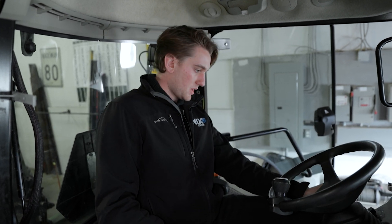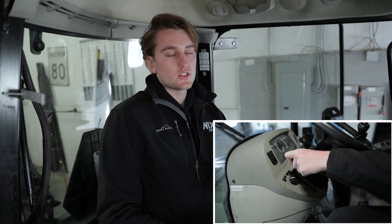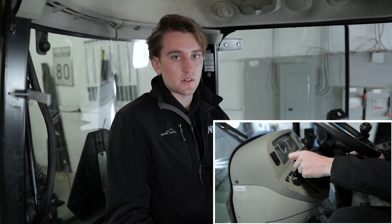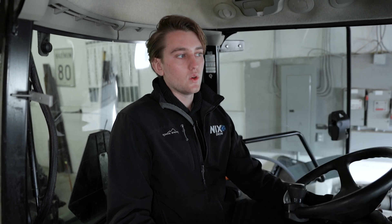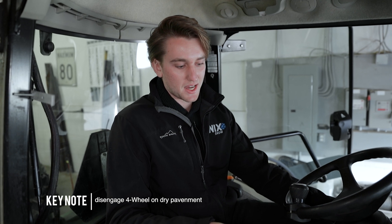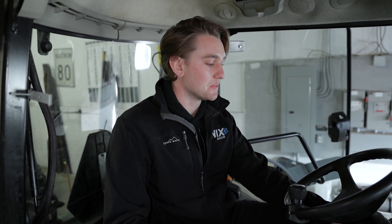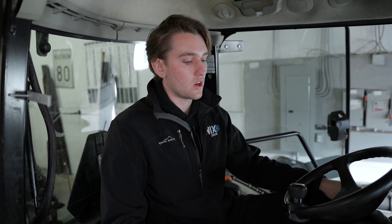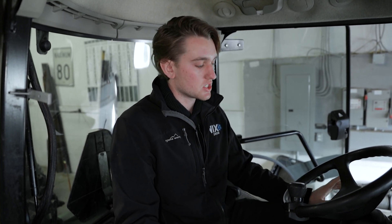On the left we have four-wheel drive control. This machine has snow tires on it. A lot of the time you're actually not going to need four-wheel drive. When you do, it's fine to use it. You just have to make sure you're not running it on the road if it's dry pavement — that is very bad. You'll wreck stuff. So make sure you're in two-wheel drive if you are driving on a dry surface. If there's a bunch of snow on the road, it's fine, but just be aware of that.